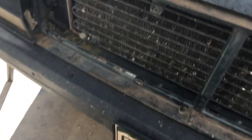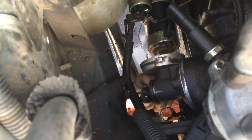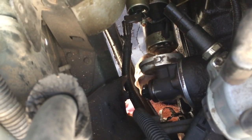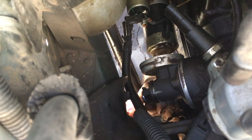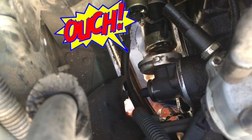The reason being you cannot fit anything in there other than that. With the T60, you end up putting a 12 over it — that's 97 and up. If it's a 9/16", which is 96 and older, then you're going to need a 14 socket, usually, depending on which socket size you use.